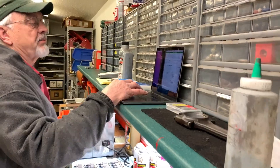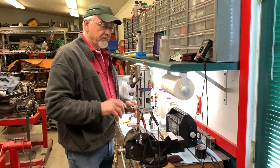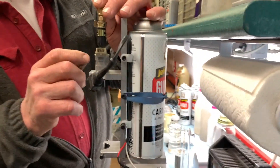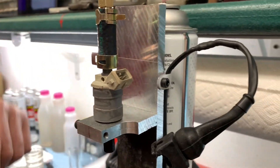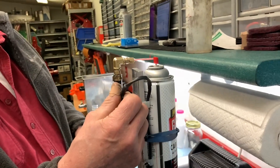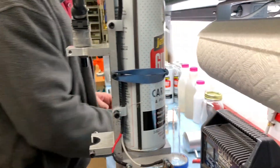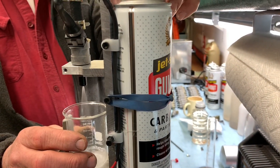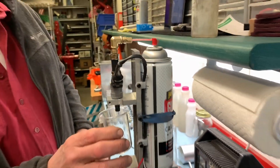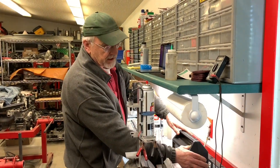The next thing we're going to do is take a look at the pattern. What we're looking for is a nice conical pattern, so we plumb up the injector just down to the first barb. Remember, if we go all the way it's going to be really hard to get it off because that's what a hose barb does. We get this thing pulsing and here we go — we've got a nice, beautiful conical pattern.